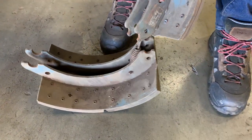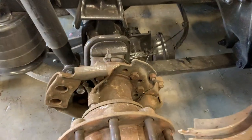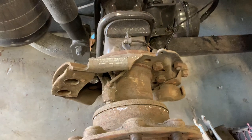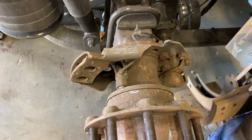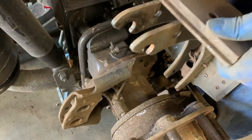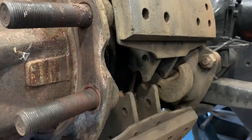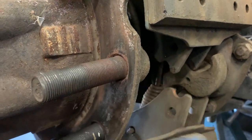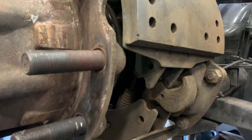I'm going to hook this large spring in. The hardest part is getting this spring around the S-cam — I need the spring to be on this side of the S-cam. You can't have it on the other side where the S-cam is going to rub up against it. As the more times you do this job you'll gain more proficiency and naturally get faster. As you can see, that went together and now the spring is on the correct side of the S-cam.